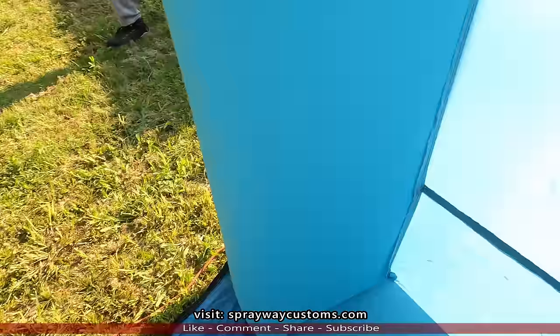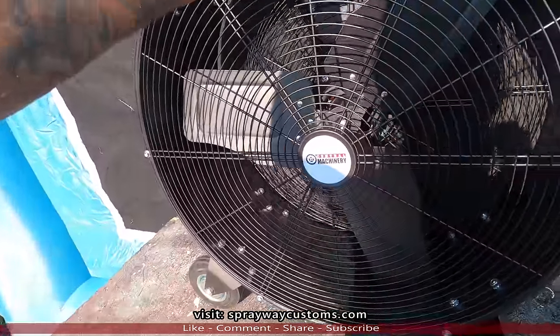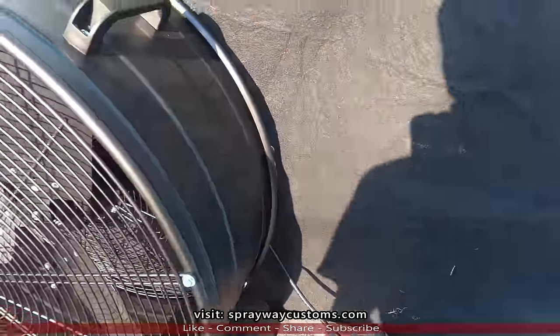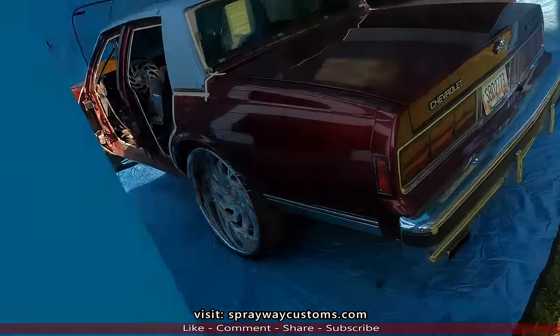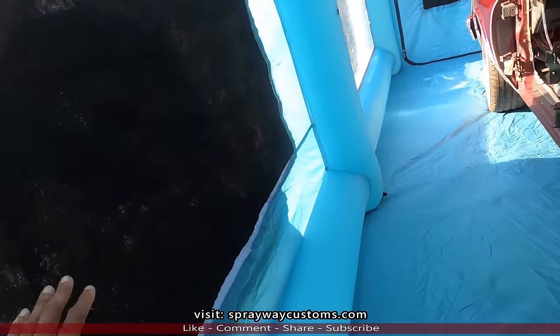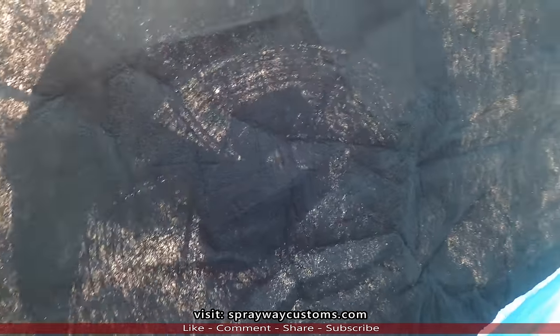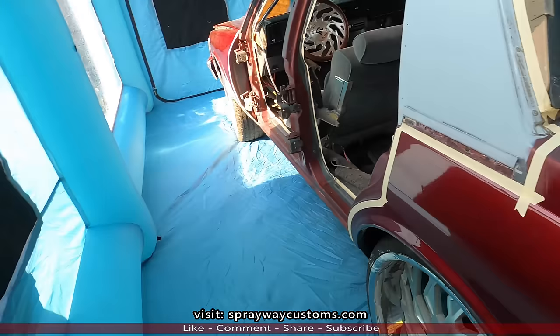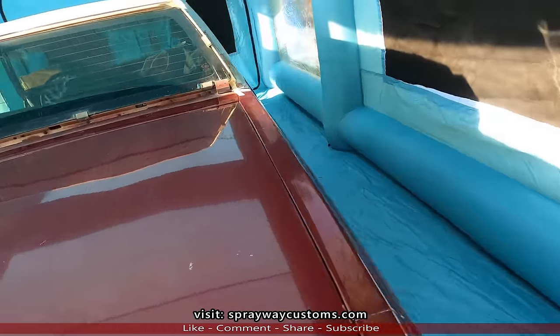Let me show you what I got right here. I just rigged up something. I don't know if it's gonna help. I got a fan. I'm gonna use that exhaust fan. I just got it sitting up against the vent. If it helped, I'll let y'all know. But it should pull some of this overspray. Guess I go ahead and mask it up. Well, not mask it up, but put the plastic over.